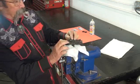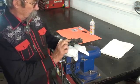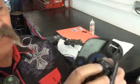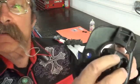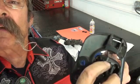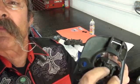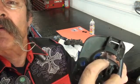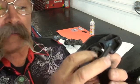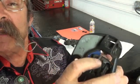Now the area you're going to work on in the clasp is right here where it comes across the lock. If we take a look at another latch, we can see that there's a shiny spot right here. Can you see that shiny spot right there? And we're going to use a pin punch or a punch, and we're going to go 6 millimeters from this edge, over, and then 6 millimeters. Now when we drill the hole, we're going to enter this pin that holds the clasp. So as we drill, you'll see the shavings are going to change.